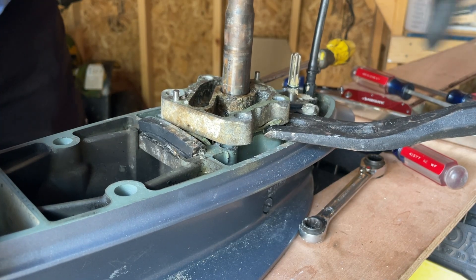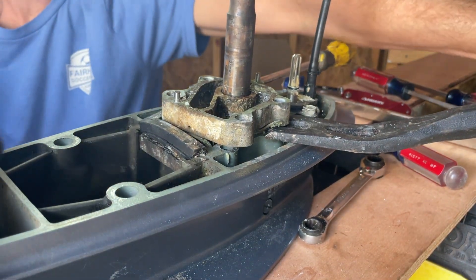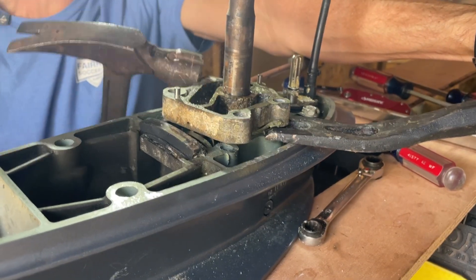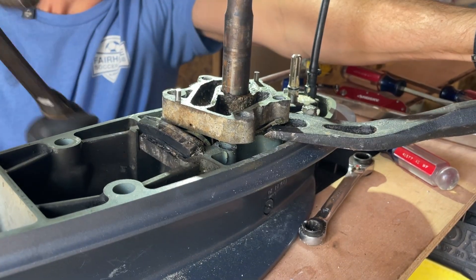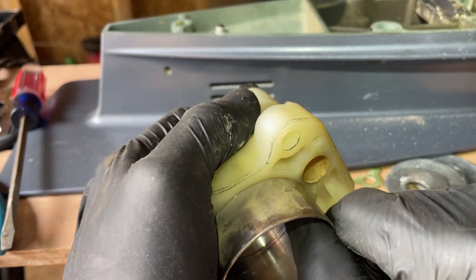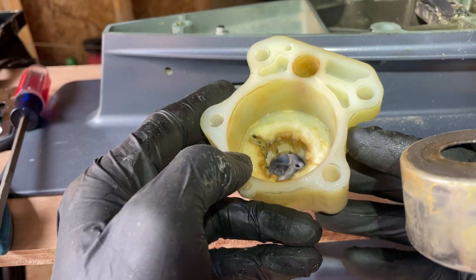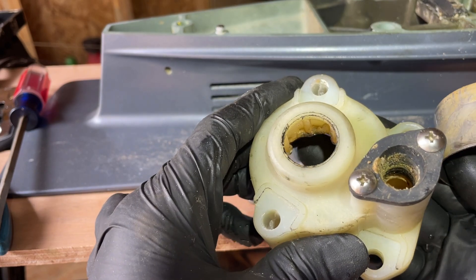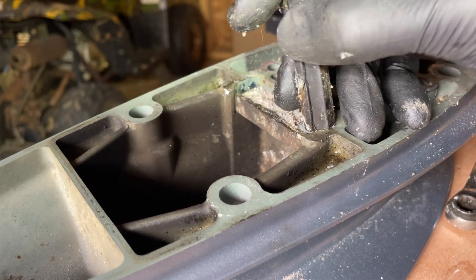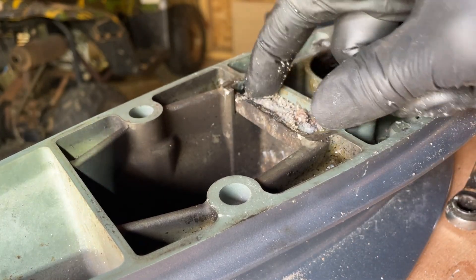I've got a big pry bar on one side and a big flat screwdriver on the other. I'm holding weight down on both while rotating this as I hold pressure going up. On the top water cover housing, which is plastic, you'll see a little metal cylinder that you should be able to slide out. You can look and see if there's any damage on the top of the housing — in this instance there is. The plastic has been melted a little bit, so we're going to replace this housing as well. This is also a good time to check the seal, and you can see there's a crack in it, so we're going to replace this as well and clean everything up.